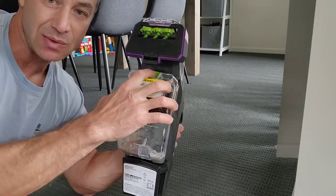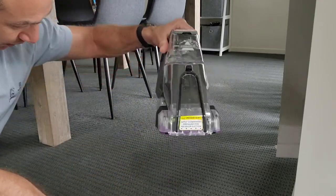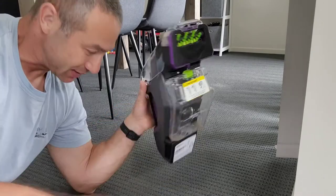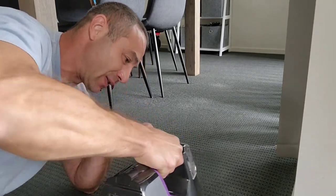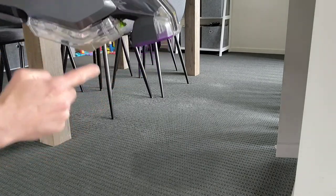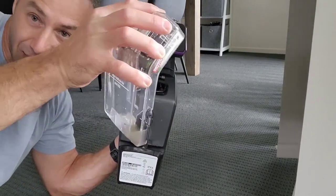We unclip that reservoir — let me put the appliance up. That's a good example of what not to do: you need to drain a little more water first. As I remove the reservoir, water comes out, so I needed to tip it down to get it out. I'll suck up what just came out of the appliance and explain what happened.